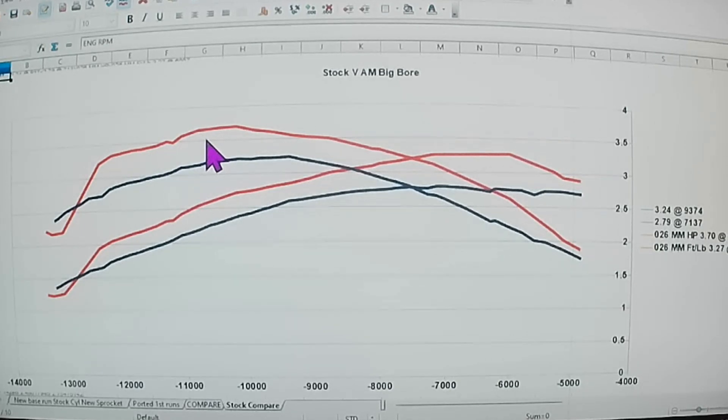Well, we got it figured out. We pulled out the endoscope and put it down the cylinder. I ran the endoscope in the cylinder and this is the first thing I see - that's probably 3/16ths wide, three or four millimeters deep, just guessing. I'd say I got a piece of carbon out of the muffler - I thought I had it cleaned out good. Must not have, and it ruined the cylinder. There are about seven scratches around there deep enough to catch a fingernail in. We weren't building compression - it never did start feeling like it was seating a ring, so I put the endoscope down the spark plug hole and that's what we came up with.